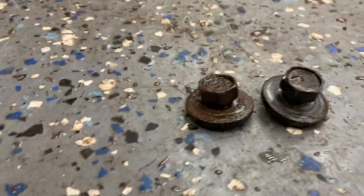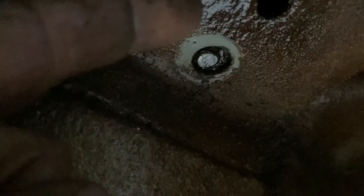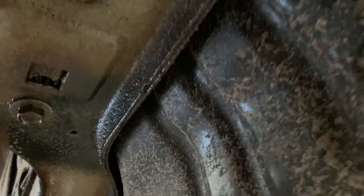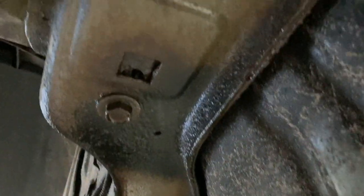Let me show you how we're doing so far. We've broken off both of the smaller diameter bolts — one on the passenger side and one on the driver's side, both all the way to the rear. I was taking them in and out a little at a time, spraying them. They both actually broke off while I was trying to put them back in, because I could only get them to come out maybe a turn and a half. The 18mm bolts have not broken off, but they're stuck as well. I'm assuming the whole channel and everything inside it is rusty.